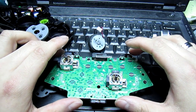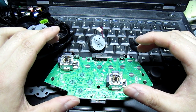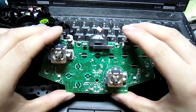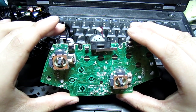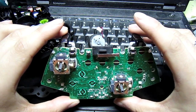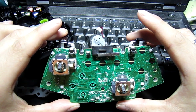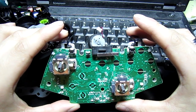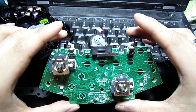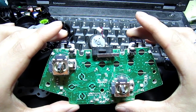But on one of those company sites, I saw a function that I found quite intriguing. It was adjustable hair triggers. Normally you push your triggers down a certain amount before they actuate. These are analog triggers, so they are touch sensitive, and where you push them further down, they do different things. If you use your controller as the DVD remote, or even in Black Ops Theater mode, when you push it down more, it speeds up or reverses faster than if you push it down less.